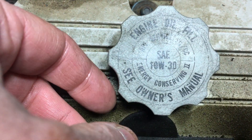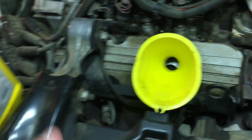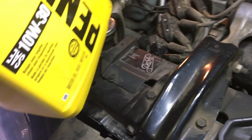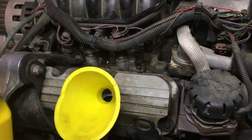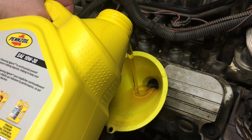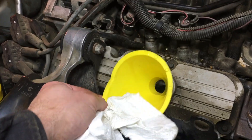With our mental checklist: we drained the oil, changed the oil filter, and put the drain plug back in — all sealed up. Now we're ready to add oil. The cap says SAE 10W30. In the owner's manual you can use 5W30 for cold temperatures, but since we never hit single digit Fahrenheit and I always plug it in, we'll go with 10W30. We're putting in most of the five-liter jug — about four and a half quarts. I've got the big yellow funnel in there to make things easier while holding the camera.